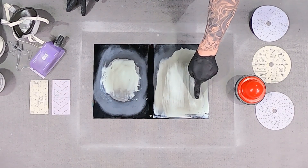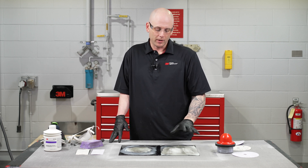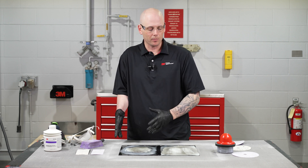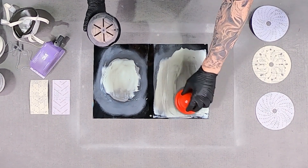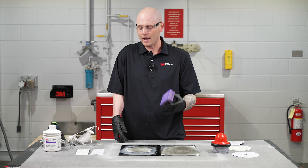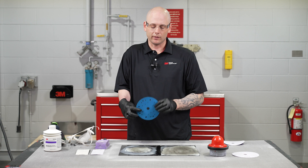It also gives us a really good picture of what our scratch profile looks like. We're using 80 grit, so this is a very coarse scratch profile. Wet guide coat will also do this, but it won't get down into the scratches. So for this first bit of sanding maybe it works fine, but let's say we blocked this out and now we're ready to move on to finer grit paper. I'm going to reapply my guide coat — turn over the canister, knock off the excess, and rub it on one more time. Now as I start to sand this with the DA and finer grade paper, you'll really be able to see the sand scratches I just put in with my 80 grit, where a wet guide coat wouldn't show you that. I'm going to put some 180 grit on the DA and sand this down so you can see those sand scratches underneath.